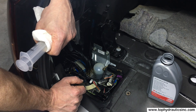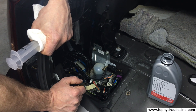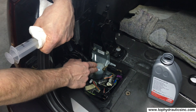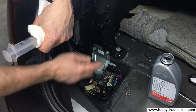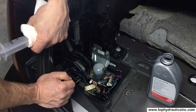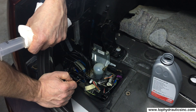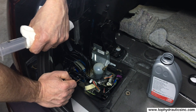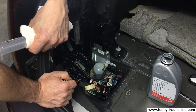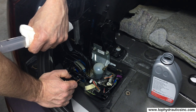It'll take several cycles to get all the air out of the cylinders before you can finally adjust the fluid level to where it should be. We will run the top now and cycle it. This will be enough fluid to do almost a full cycle, and we will have to refill and cycle it a few more times, then do the final adjustment. You don't want to run this pump for more than a couple of full cycles without a break, because the electric motor will overheat and throw error codes on the computer. Prevent that by cycling the top twice, giving it a five-minute break, then cycling it another couple of times and finally adjusting the fluid level.